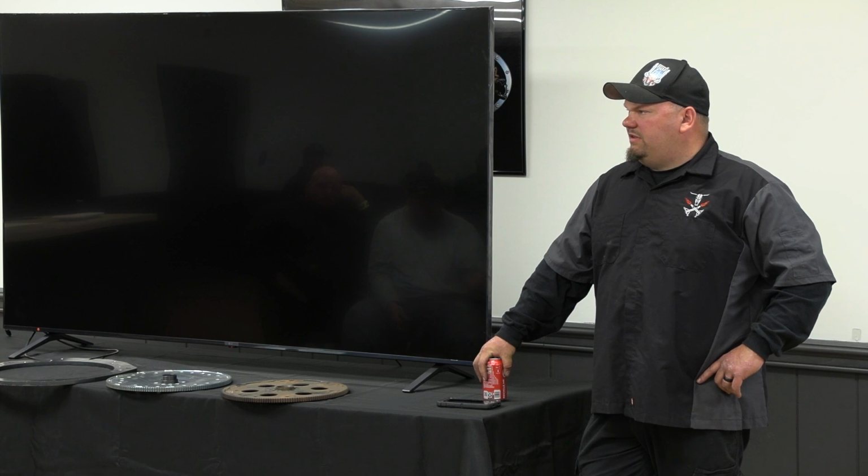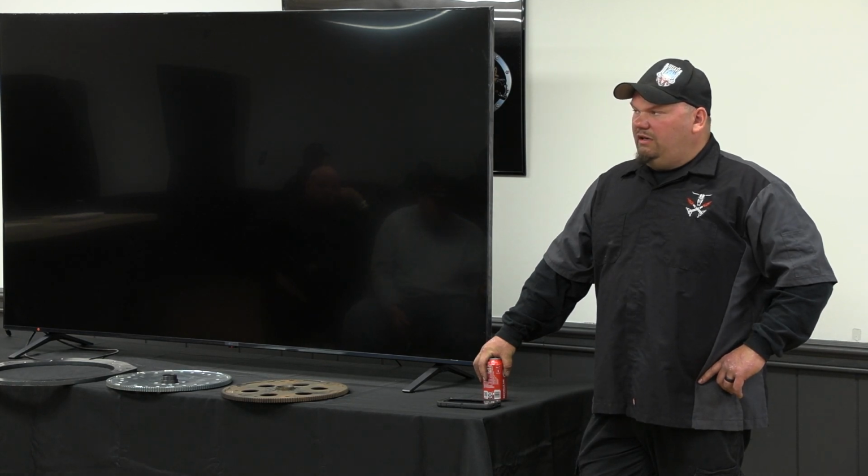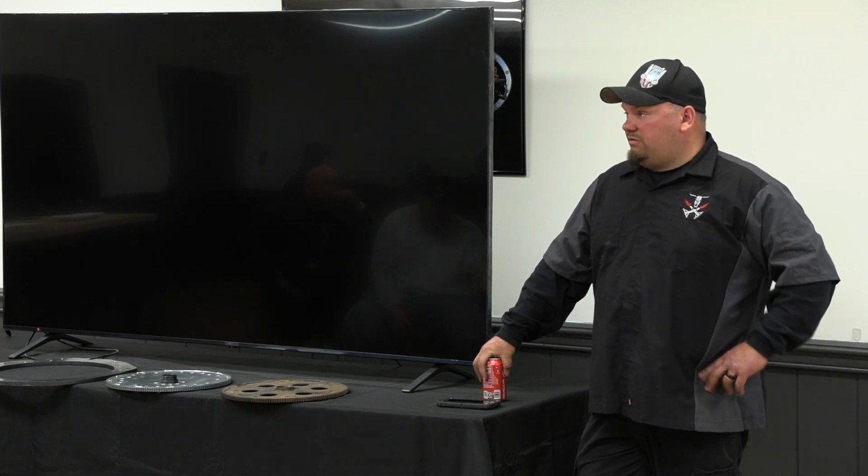That's what they do with Powerglides and some of the drag cars. They have an external filter. They check it between rounds. They flush them between rounds. They chill them between rounds. That's the stuff I know about.